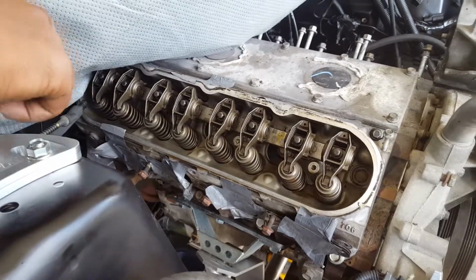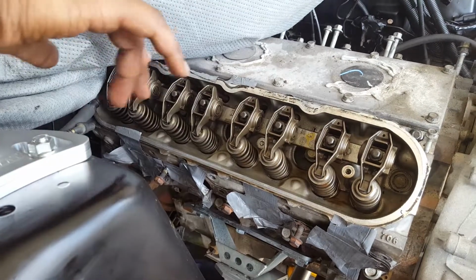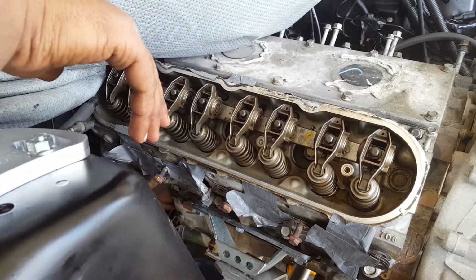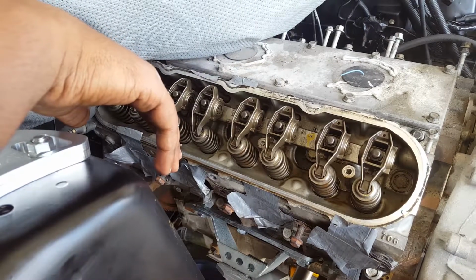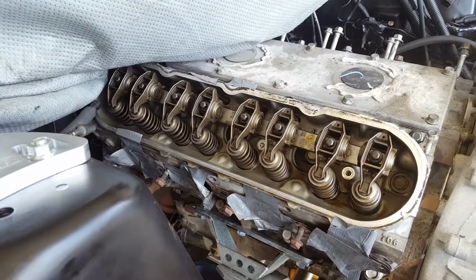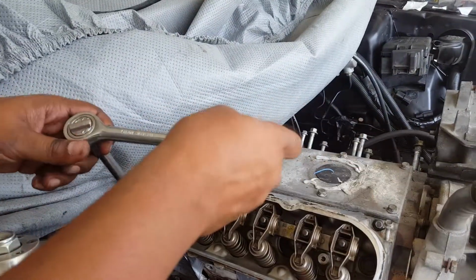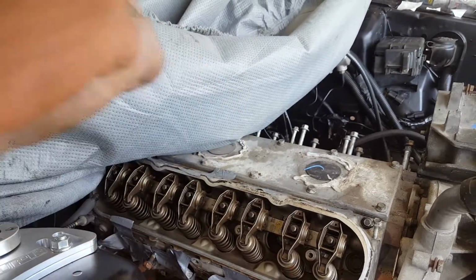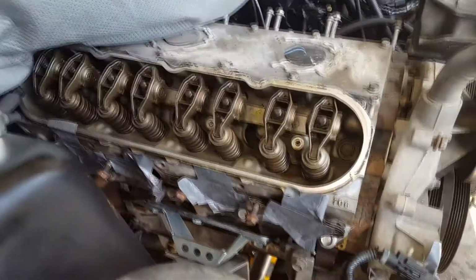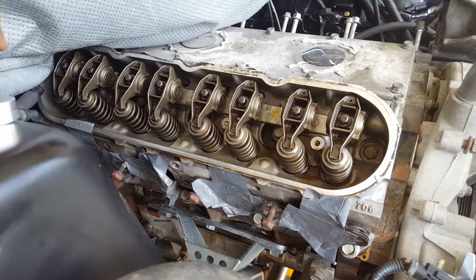So guys, once you torque it all down, 25 foot-pounds I like to say is around as tight as the max effort you can put in with a ratchet. It's pretty tight. Just with the 3/8, no super long ratchet or anything like that. Just normal, just trying to go at it. It's definitely up there, but I use the torque wrench, so it was way easier. But in case you guys don't have a torque wrench and want an idea of it.